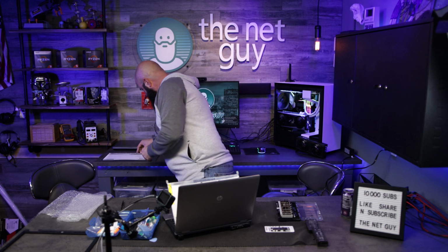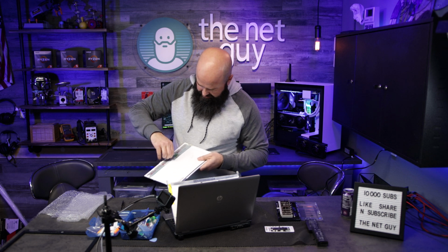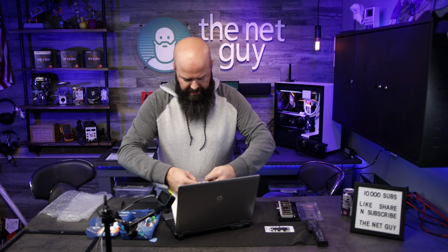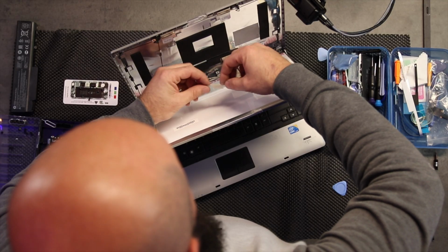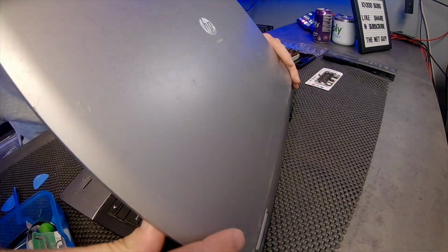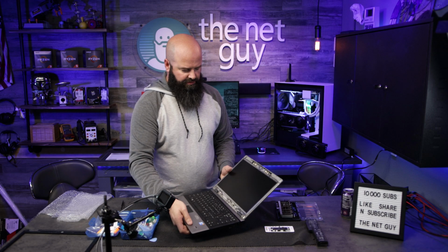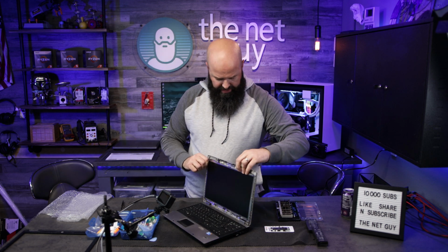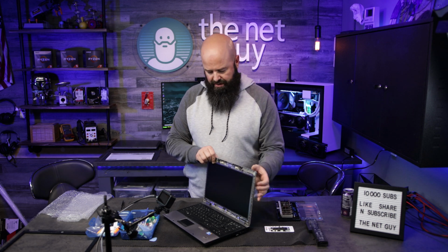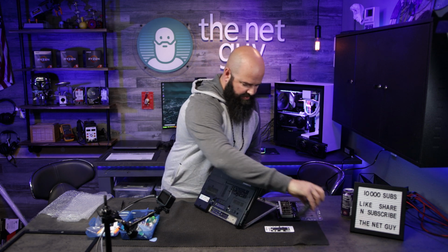And actually, I'm going to borrow that piece of tape that's going across on the old one. Now, this doesn't look like the official Kapton tape, the yellow tape that you normally see that's non-conductive. But do this for sure if you want to make sure that your display is connected and stays connected. So now I've done the connection part here. I want to just test that this new screen is working. So what I would recommend is putting the battery in at this point now and being very, very careful, obviously, with everything else that's in here.